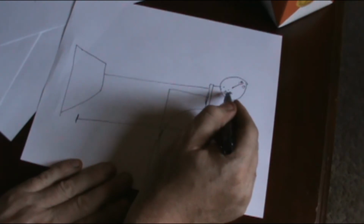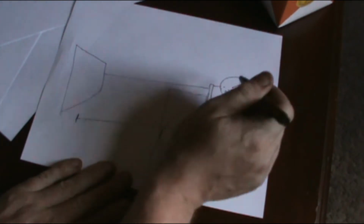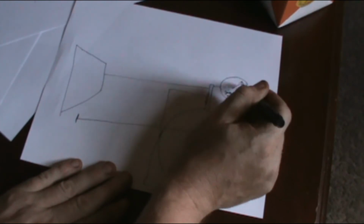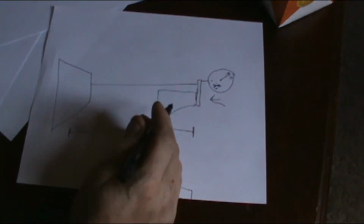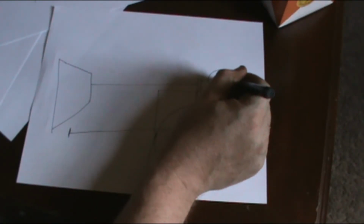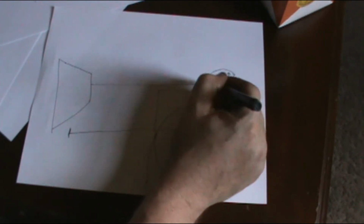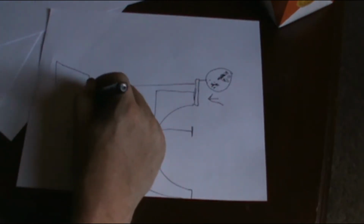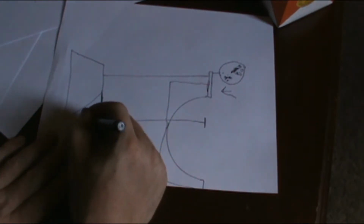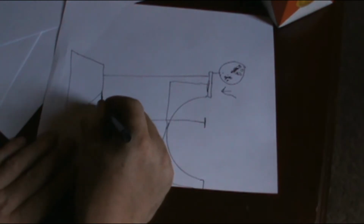Actually, if it's pointing at the 2, close to the 2, I'd say it's 190 thousandths. That's probably confusing as crap. If it was pointing somewhere right here, it'd be closer to 3, it'd be 290. But now that I'm looking at it, let's just say it points at the 10, 210. 210 thousandths. So that means that this distance from here and our known distance of 3 is 210 thousandths.